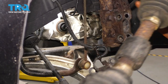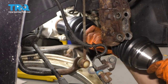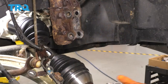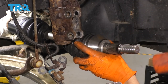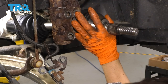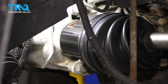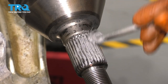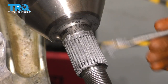Slide out the old CV axle. Now take your new CV axle, slide it in, and line it up with the splines on the transmission. Wiggle it around to make sure it's lined up, then give it a quick push to start locking it in. Take a rubber mallet — not a hammer — and tap it in until it fully bottoms out on the transmission. Before the axle goes into the knuckle, put some anti-seize on the splines so it doesn't seize up in the knuckle in the future. Just a light coating on all the splines is plenty.